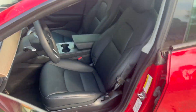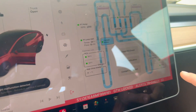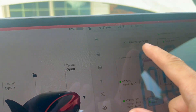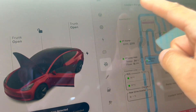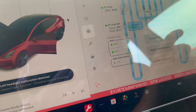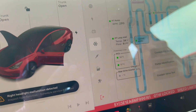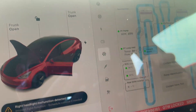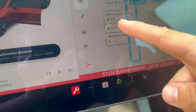In service mode it looks like this. All you have to do is press 'Coolant Purge Start.' If you press any of these options prior, it will not let you do it unless you wait about 20 to 30 minutes. You can also try pressing fill, top it up to the max, wait for it to clear out, and then start the purge again.